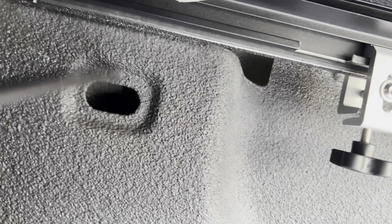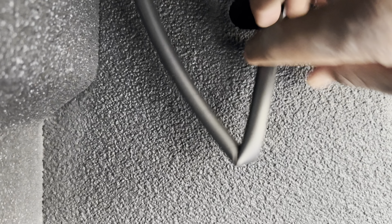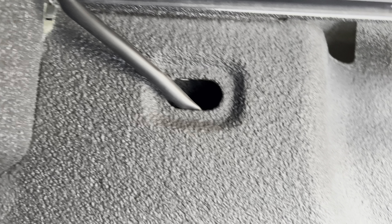The next step says to put your drain tube inside of the bed — open it up. So right here is where we're gonna tuck away the drain tube. Make sure you don't leave it kinked or anything like that — try to make sure it goes flush so you get proper drainage. You don't want it tightened up where it can't drain. You can see how it has to run straight like that. It's a little tight, so we're gonna loosen it a little bit — boom, just like that. I'll do the other side and get back to you with the next step.